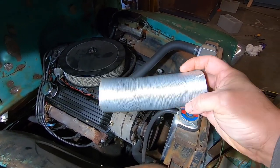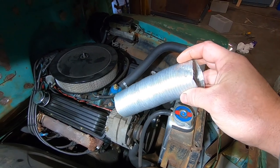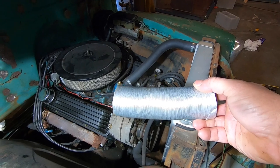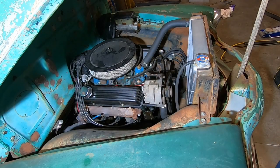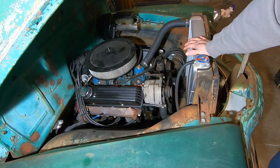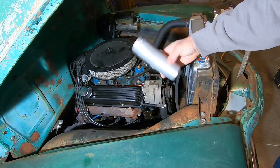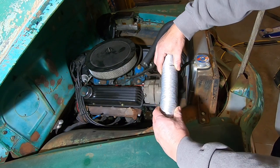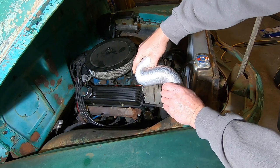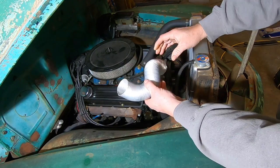It's just a piece of aluminum duct — this is what goes up under your dashboard on older cars and trucks to connect your vents and defrost vents to your heater. Now you may say, how's that gonna help? Well, here's how. Let's say you're building that custom classic truck, hot rod, whatever it is you're building. You've got the engine in place and you've got the radiator set where it's supposed to be. Now is the time that you break out this highly specialized technical tool, because this is about the same size as a radiator hose and because it's expandable and flexible, I can bend it to whatever shape I need — and now I've got a pattern for what kind of hose I need.